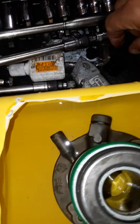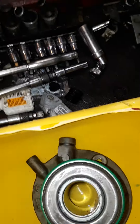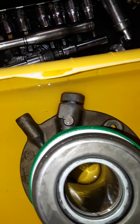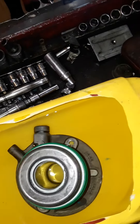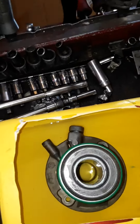Then you have a cap. When you take it out, I suggest letting it sit in there. You're gonna get air bubbles — let it sit where it bubbles. Air comes in, let it sit. Pump it a few more times, put a cap on it. Before you install the hose, so you don't make a mess and get more air in it. Reinstall it in the transmission.